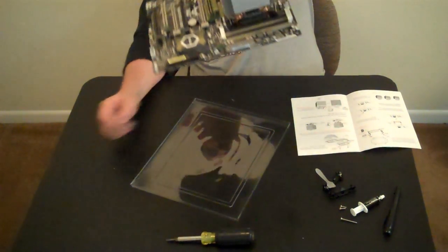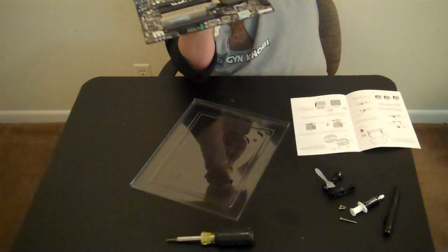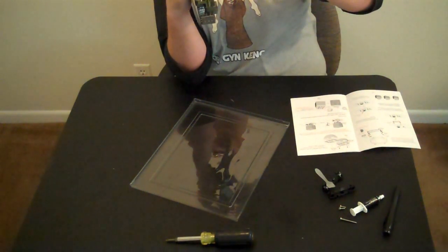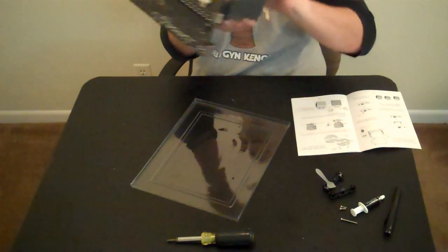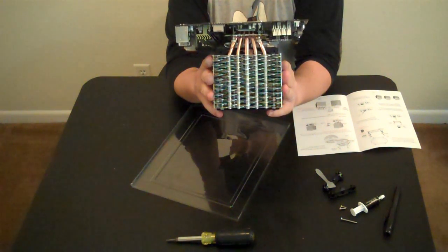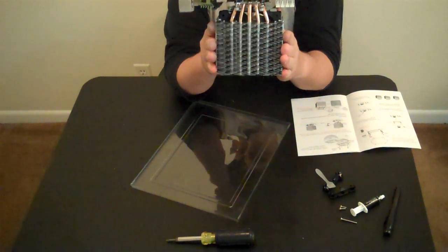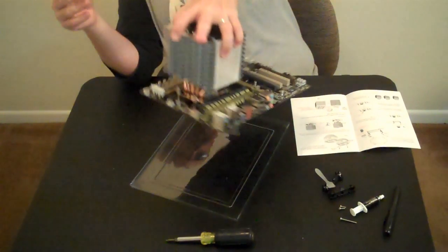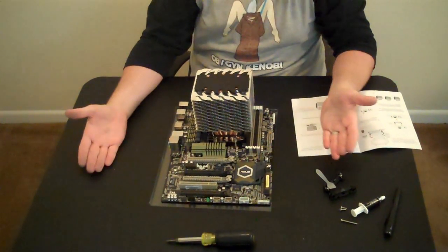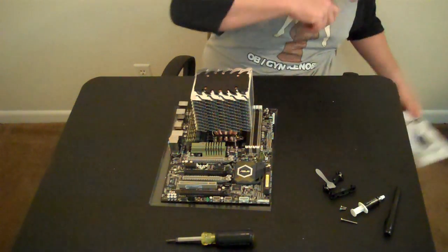Because it is perfectly mounted, I can lift the entire motherboard using just the heat sink — which tells you that you've got good pressure. By looking at it, the heat pipes are making direct contact with the processor, and some of the thermal paste is beginning to squeeze out, which is what you want because it's thinning out the thermal paste automatically. So here is a completed motherboard, processor, and cooler combo set. Now I'm going to go ahead and throw the RAM onto this and see how well that goes.